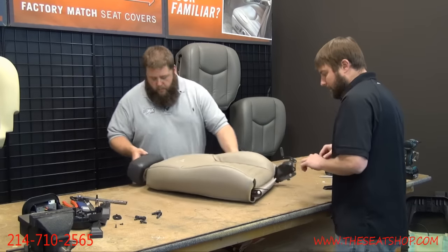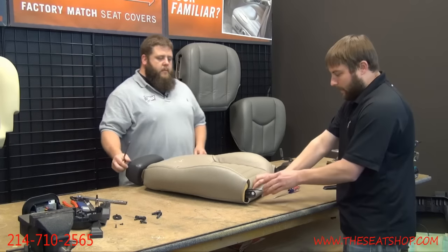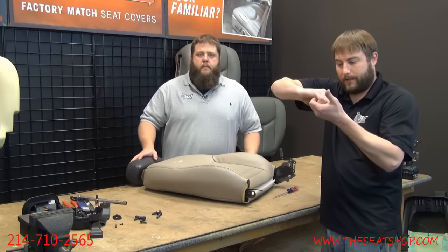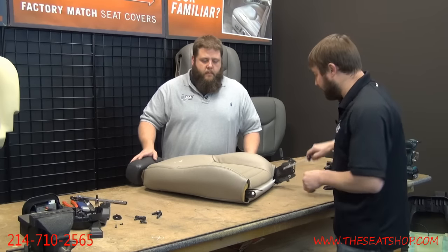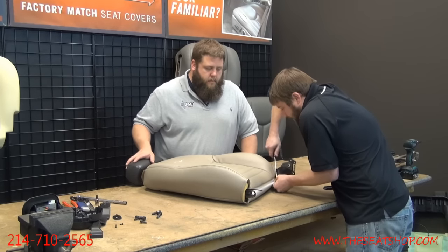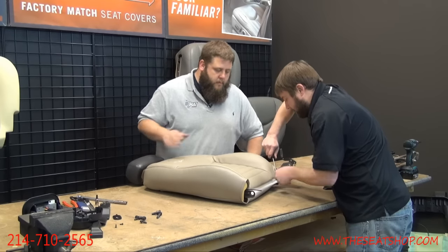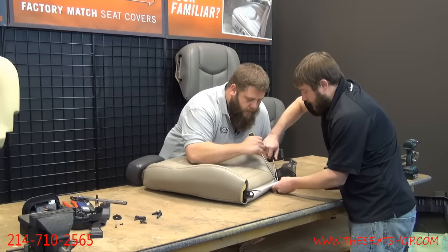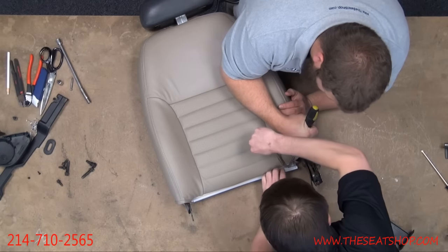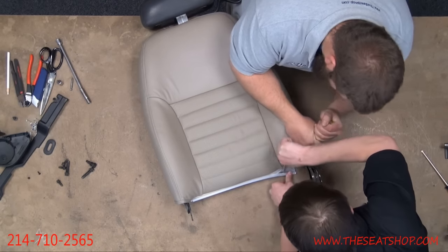There's another flathead under you. Okay. There we go. All right, this one long clip interlocks. It grabs two J clips that interlock together, and it has a little catch in there. So you just get on one side of the plastic and start pulling it off. Now these can be a pain too, and it does help to have two hands, especially to put it back on. If you can hold that. Hold this here, yeah. Once you've got started, if you get someone else to hold the screwdriver there so it doesn't reclip. There we go.